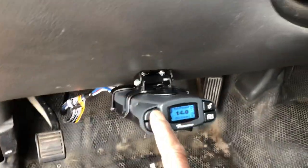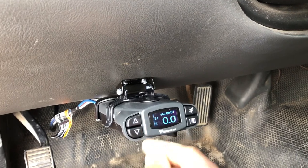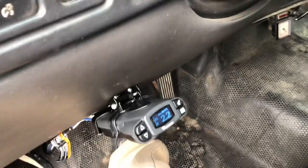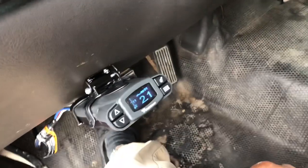All right, now this is where you set power. I'm setting it to max, just temporary. And it's gonna be trailer one. So I have the option to set how many trailers. That's where we see pressure while not moving. Now, this is the part where I tell my wife to come out and put her foot on the brake for me so we can listen for the sound.